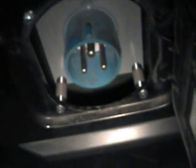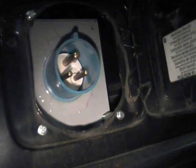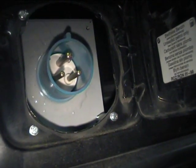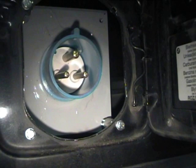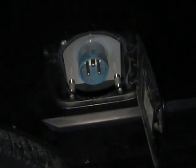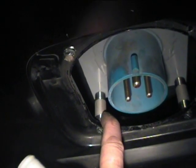As you can see, the fuel filler door closes over on that 100%. It's basically fabricated from a piece of 6mm aluminium that was drilled out to take a standard 32-amp single phase plug, which we cut down so that it would fit inside the body - the frame area that had been taken up by the old fuel filler. It's just stepped back in there with some pieces of stainless steel here, just to push it back so that the filler door can close.